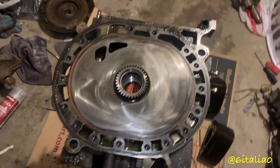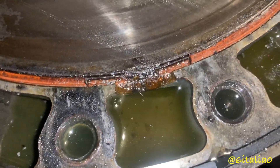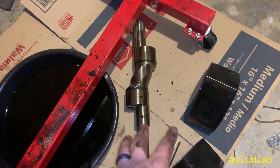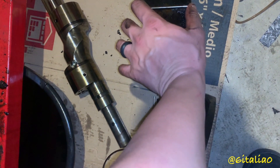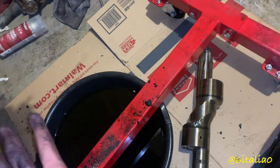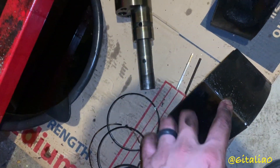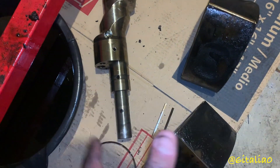Unfortunately this iron is dead — you can see right there, it's cracked completely open. But some cool things I did see: on the front rotor the apex seals just popped out, and they're actually three-piece seals. It looks like a rhino seal at first glance, but it's actually three separate pieces of the same seal. You've got your corner seals over there, your top piece here, and the bottom piece that sits in the bottom. From what I was told, these ones seal the best and have the best heat dissipation.